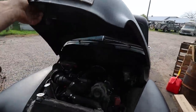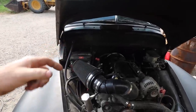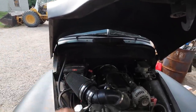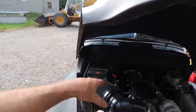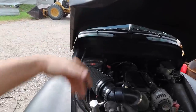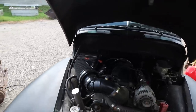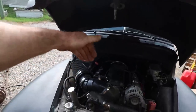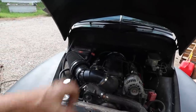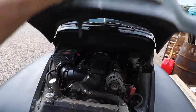we ended up figuring out it was an intermittent spark issue on the one side, and it just turned out it was a bad ground wire. I didn't put it together, but I did check it, and I thought it was tightened. Then the other night a bunch of us were sitting around here, and I was digging around, and I realized the one wire was loose, so win, fixed that all up, so she is good to go.